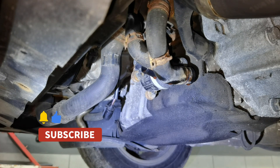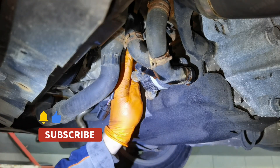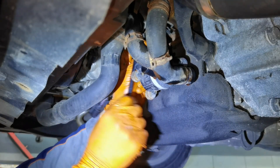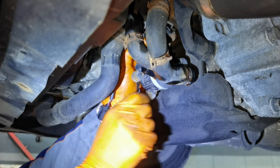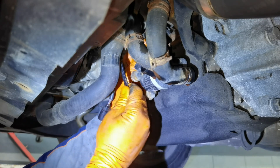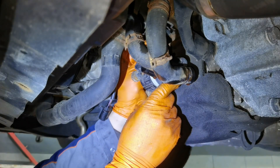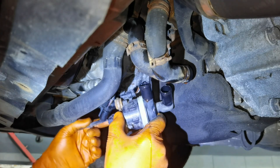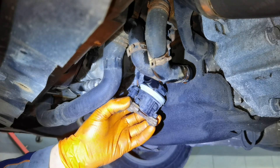The coolant is out from the engine and now I can move ahead and remove the bracket securing the auxiliary water pump to the engine. After that I'll remove the auxiliary water pump from the bracket, install the new one on the bracket, and then install it back on the vehicle. After disconnecting the bracket, you have to disconnect the connector — the power supply for the auxiliary water pump. I recommend using something sharp, putting it underneath the plastic clip, pushing it back, and it will release and come out from its place.